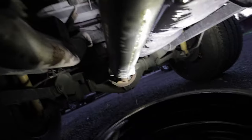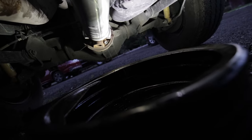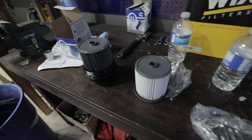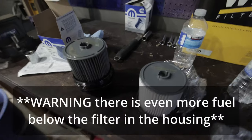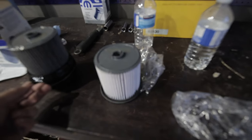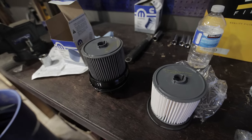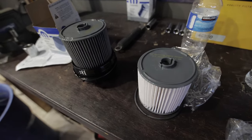Fair warning — a bunch of fuel came flying out of that. It was so tight and I kept going and going and then all of a sudden it popped. Fuel flew everywhere, so take your time and just be prepared — it's going to come flying at you. It's a little bit of a different design on these '22s with this cartridge style. We'll change the O-ring and get the fuel filter changed. I see I've got an extremely loose O-ring here — transfer that over, put the new filter in, reinstall and tighten it up. You're going to feel it bottom out and that's pretty much it.